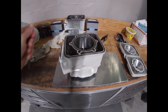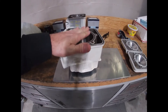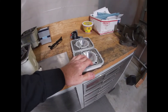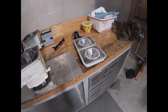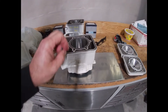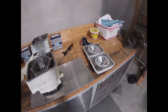So you put a thicker gasket on there and that raises the cylinder up. The difference is only about four thousandths of an inch — basically the thickness of a piece of paper. You want to put the next thicker gasket in to make sure the cylinder is lifted up high enough, which in turn lifts the cylinder head high enough so the piston and the dome have the correct clearance. Too much clearance and you're just down on power a little bit — not a big deal. Too little clearance could be really catastrophic. You could throw this together with a 20-thou gasket, but you're shooting in the dark if you don't know what that gap is.